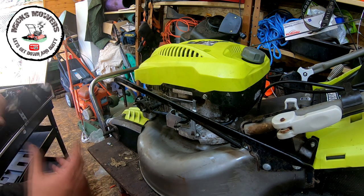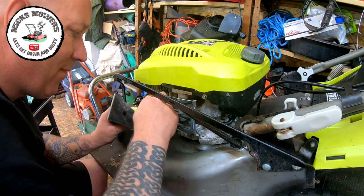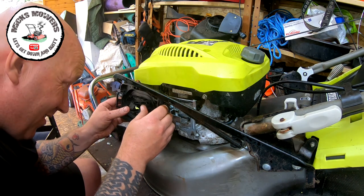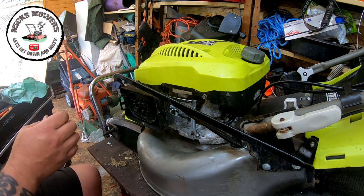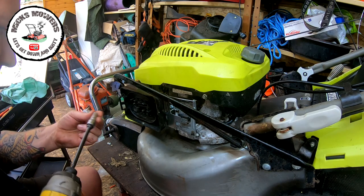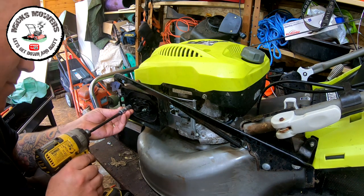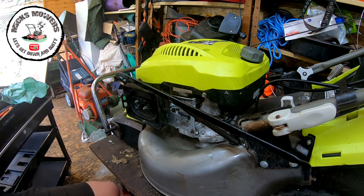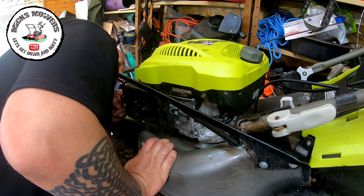Air breather pipe goes on. I've got to push that back so that fuel hose doesn't impinge upon the governor. That all goes on - tightening that down with the two 10mm bolts. And then that should form the seal that we need. So that's that carburetor now all on and priming, and not seeing any leaks. I'm hoping that's done it. Got a lot of fuel on this filter where it was leaking beforehand - priming lovely actually.